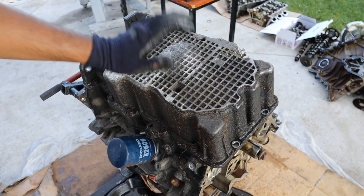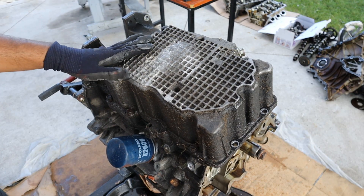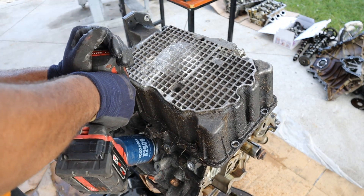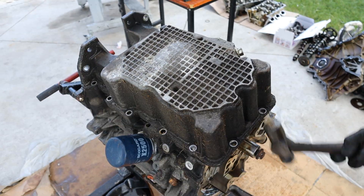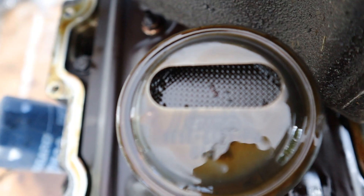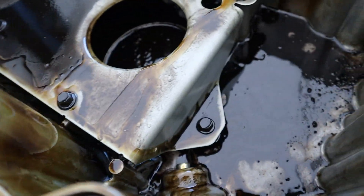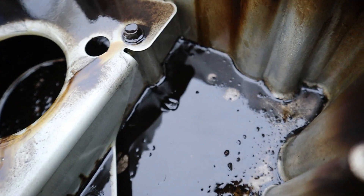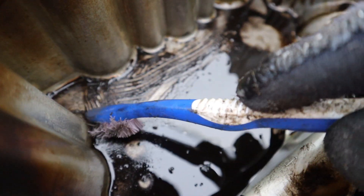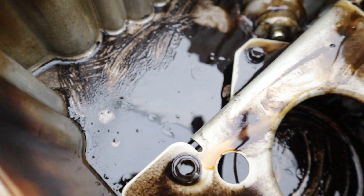Aluminum oil pan — this is before Ford had cost issues and moved to all plastic, which is obviously not good because those can crack and leak. At least this one will be a little more sturdy. I'm going to remove all the 13mm bolts going around holding it to the block. Now when an engine is sold to you as a good working engine, you don't expect to find junk inside of the pickup tube. Check out the amount of particles inside the oil pan — this is pretty sad for an engine that supposedly had no issues.